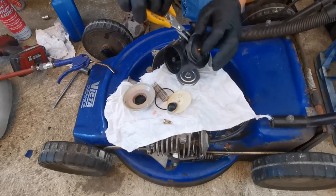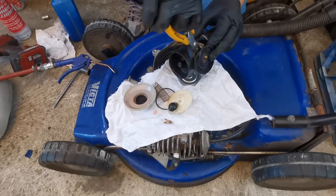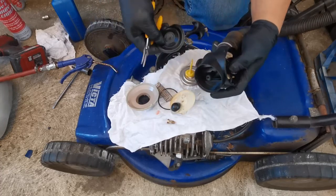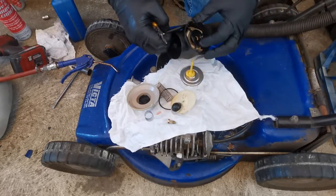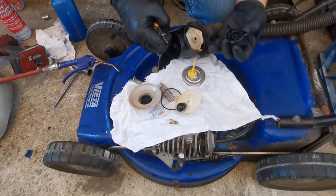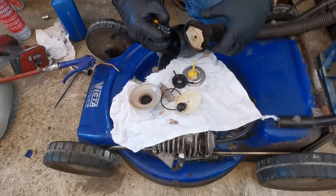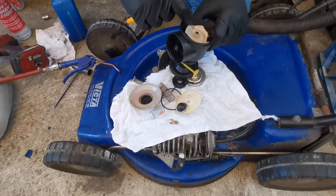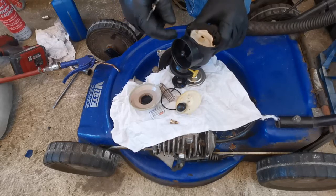To take the diaphragm out, just insert between the return spring and the diaphragm on the bottom part and wedge it. We have the poppet bulb underneath as well, so that's pretty much all removed. Inside is pretty much all clean and in good shape. We don't have to remove the throttle lever for now - if you want to know how to install it, you can see my other video.